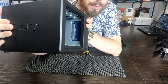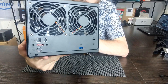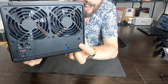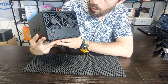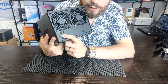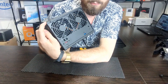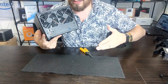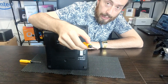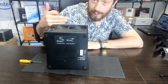Inside you can see the one memory module, but we know there's another 4GB somewhere in this device. The first thing you need to do is head to the back of the device and remove the following screws: this screw above the USB port, and this screw here. Don't worry about the fan screws on the rear. There are also screw holes here that are empty — those are for the SATA — and finally this screw and this screw that keep one half of the chassis. You'll want a Phillips crosshead screwdriver, and make sure it's magnetic, as it's very easy to lose screws through the vents.